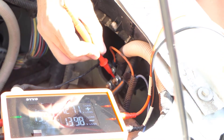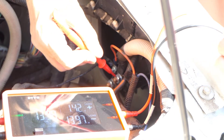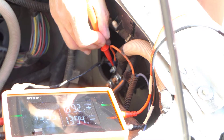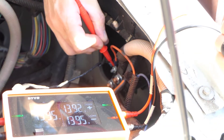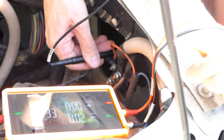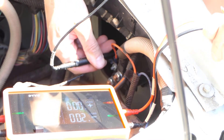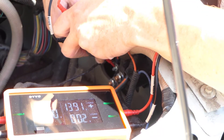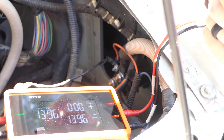And now this right here — we're losing 12.71 volts, and we only have 1.3 volts. Interesting that that's gone up. So I think there's something going on with the solenoid. Now we need to make sure that the solenoid is getting its trigger wire. Testing there — we've got 13.92 volts available, green LED, only losing 0.03 volts on the trigger wire. So I know that my trigger wire is good. Let's check the ground to this guy. We get a green LED for our ground and 0.02 volts — so my ground is good. This solenoid needs a ground, verified good. It needs a trigger wire, verified good. The positive and the ground for the solenoid are both present and both good.